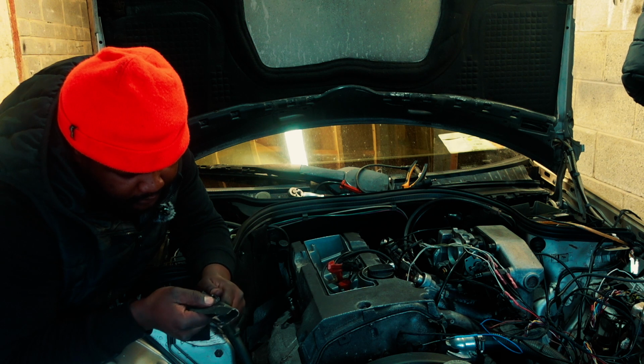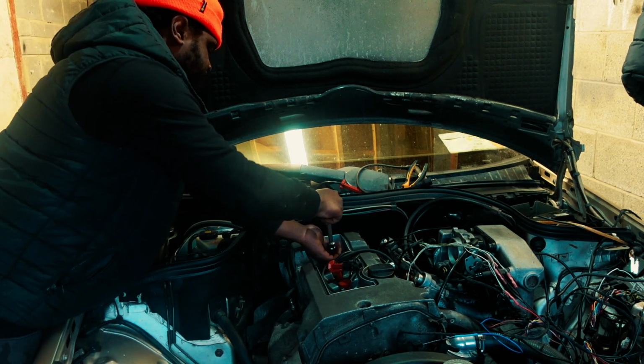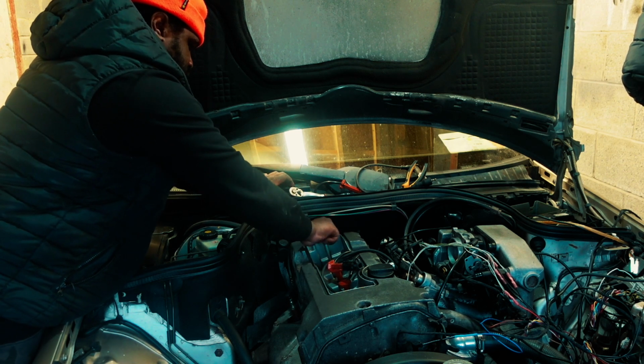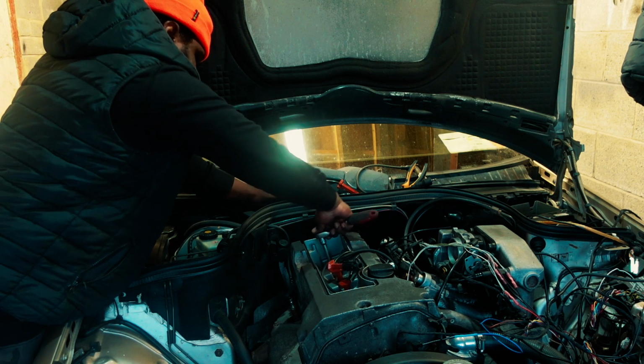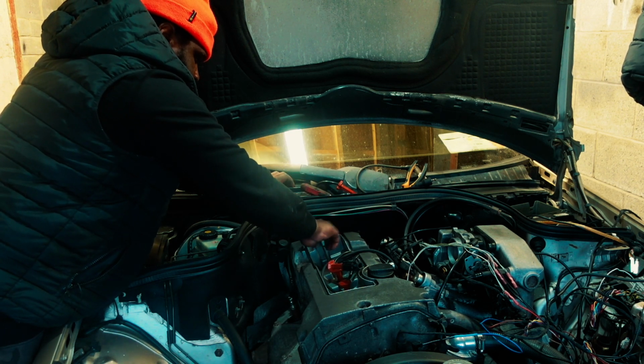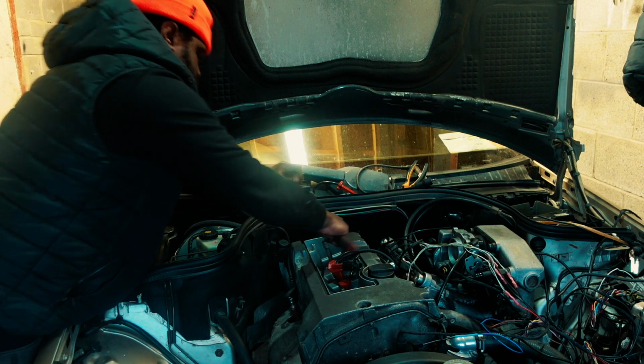It's not fully clean, but hopefully something happens. I don't know. For the sake of today and peace of mind, then I'll know next time I need to bring spark plugs. There is a lot of smell of fuel going on around anyway. So I'm getting fuel, I'm just not getting spark. Unless there's a relay that's there to do with spark, I don't know.